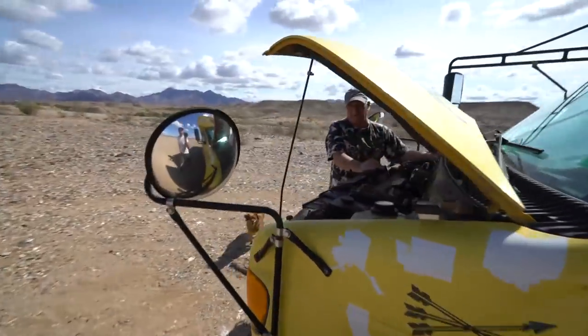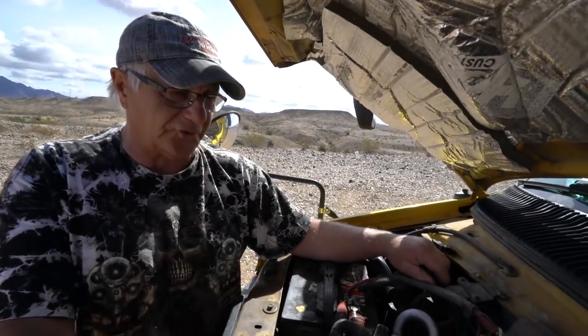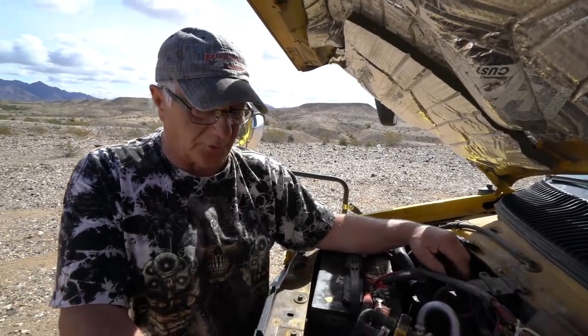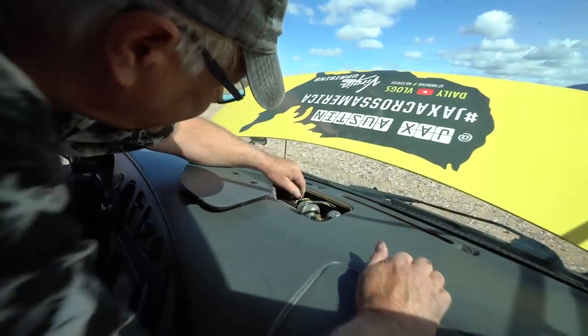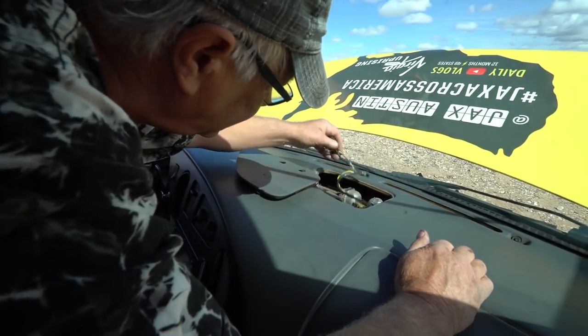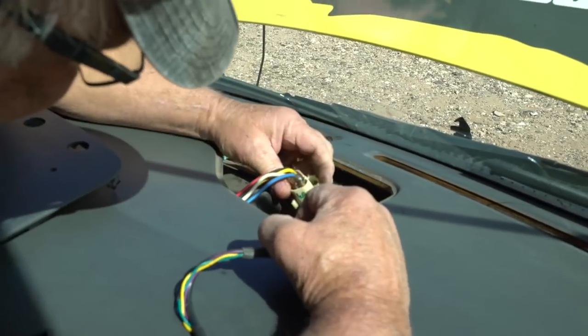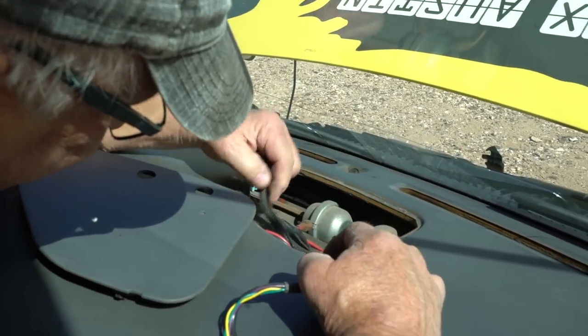All right, I think that's a good thing — we got some vacuum. Yeah, you can put a gauge on there, you probably have 15 to 20 inches of vacuum. That's what controls this one — it hasn't got electric on it, so it controls all the doors with vacuum. And that's what these solenoids are — these vacuum solenoids here. Those metal things? Yeah, right here. These are all your vacuum lines. This controls all your heat and everything.